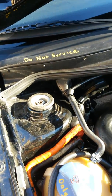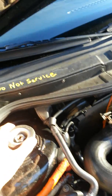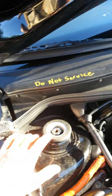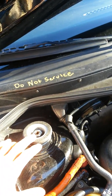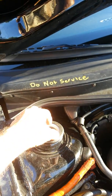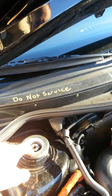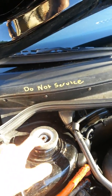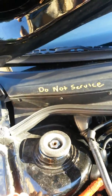You're going to have to use an offset 22 millimeter wrench and you need a 7 millimeter Allen key to get in here. You're going to have to drop the wrench in first, then hold the shaft with your Allen key. Make sure you seat that Allen key inside the shaft on this strut because it'll strip out.